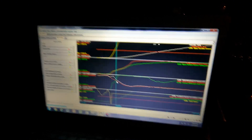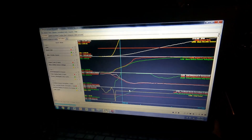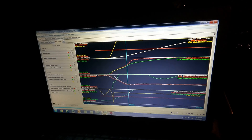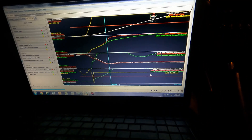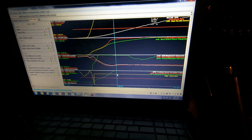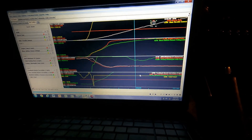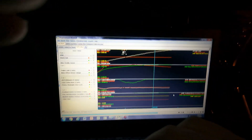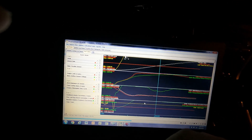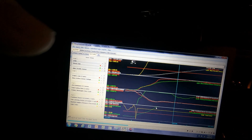You can see as I go full throttle, we max at 20% duty cycle and the boost is climbing. At 3,600 RPM I'm targeting 20 PSI, and at 3,600 I'm at 14 PSI — so I might increase the duty cycle a little bit there. But past that, we are hitting 20 PSI and holding it. No boost creep — we're holding 20 PSI the whole way through. For 91 at least, the tune should be fine. It's going to need a little bit of work up at the top end, and it looks like I hit 21, which might be overrun.